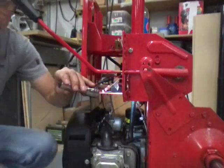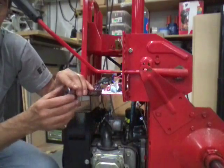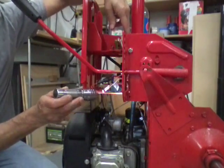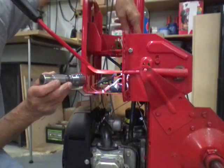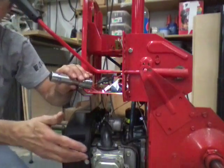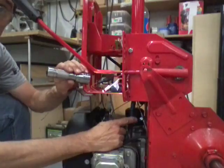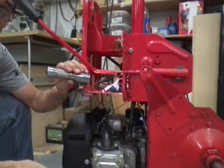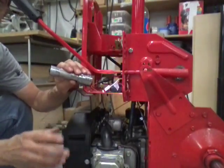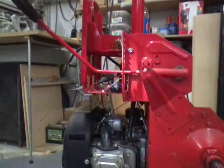There are some variables. If you have to put a new belt on your mower, there's a clamp up here on this tube that you loosen and slide in and out to tighten the belt on your mower deck. When you do that you're changing the length of the cable, so you have to readjust the clutch again — unless you luck out and there's enough movement where it doesn't mess up your clutch pedal.